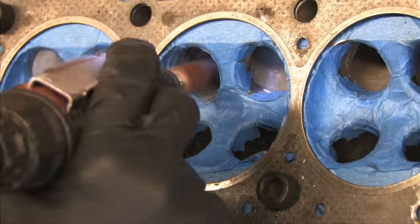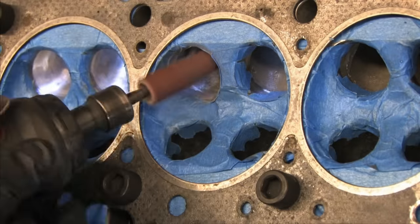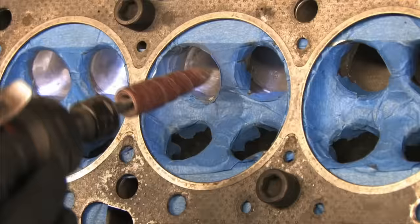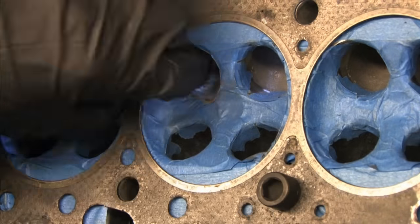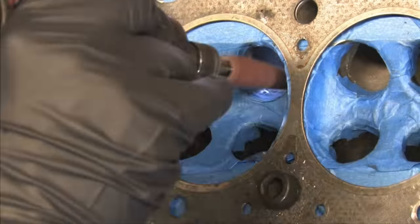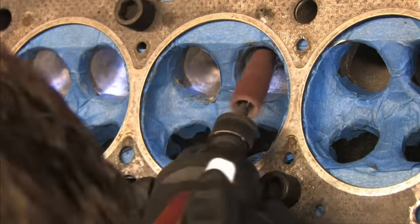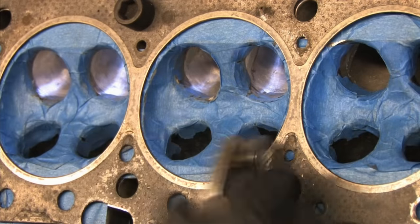Turbo, camshaft, valve, and intake manifold selection will all play a significant factor in your port job, and it's possible to overdo it on any one of those parts. Bigger isn't always better. Your goal should be to match your valves, cams, head ports, and your turbo's flow rates together, or else you'll end up with an inconsistent power band.